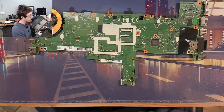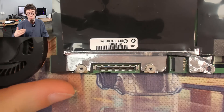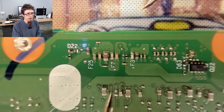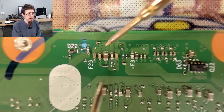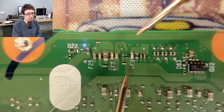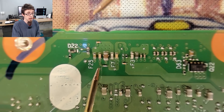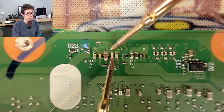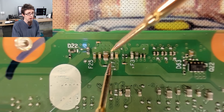I'm incredibly tilted by that. However, the good news is I think I've just spotted immediately where we need to be. Here's the display connector that we could already see while it was in the laptop. Now if I turn the board over, on the other side you can see we've got a whole row of components behind the display connector. It's not immediately clear which is the one we want because we've got like three things labeled fuse here. We've got F3, which is intact. We've got F7, which is not intact. And we've got F25, which is also intact. So F7 has blown — if that is our backlight fuse, that's the one we want to replace.